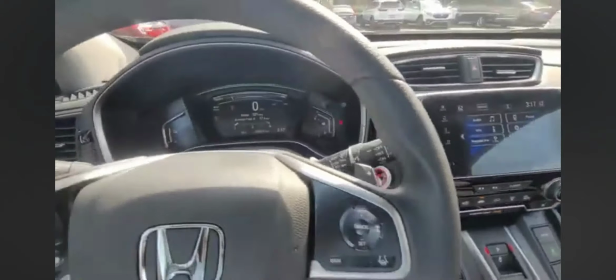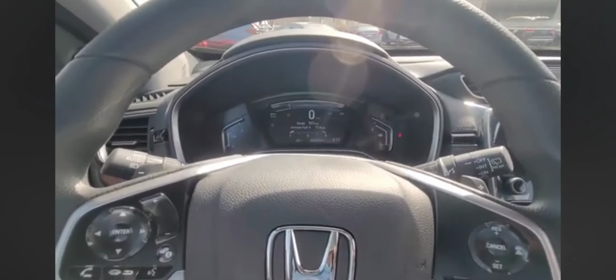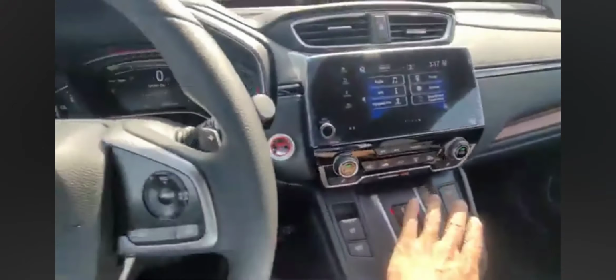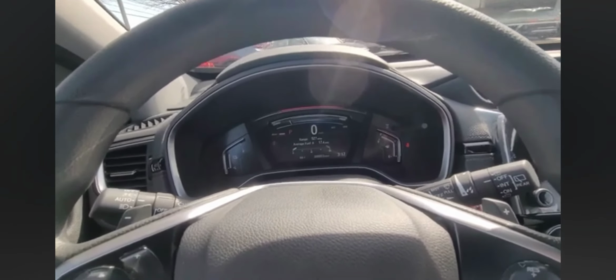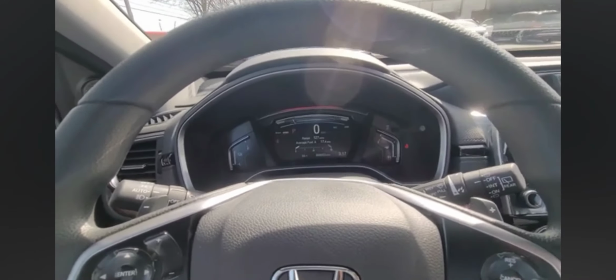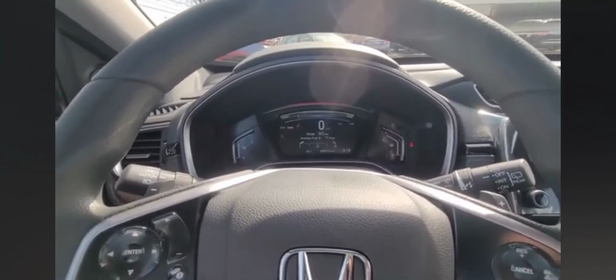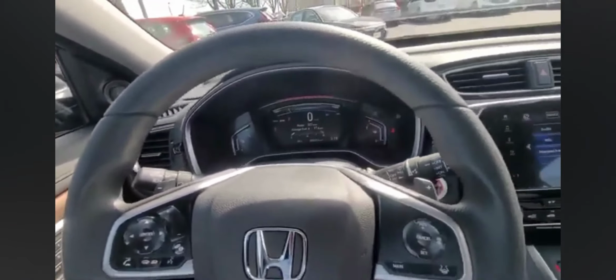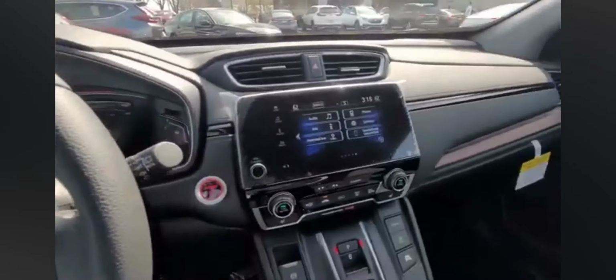You have sport mode. Well, sport mode up here, you know, right now, no modes are on. As I'm driving economically, my bezel turns green at the top there. But if I turn on sport mode, the bezel turns red, and the engine automatically kicks on. This is pretty much saying, as a driver telling the car, hey, I'm going to ask for horsepower, I'm going to ask for it a couple times, I want you to be ready. So the engine doesn't have to just kick in, it's already there. Also a good way to charge up your battery all the way full, because in sport mode the engine's running, so it is just charging the battery.